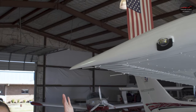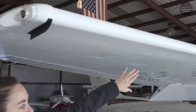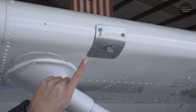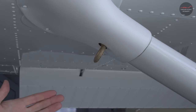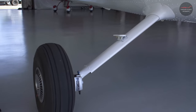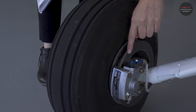Next, we'll inspect the wing tip for condition and do a scan down the leading edge of the wing. Next, conduct a visual inspection of the angle of attack transducer. If there's a tie down, make sure to remove it, then come inspect the tire. We're inspecting the right strut for overall condition, the tire for wear and condition, as well as the brake pad.